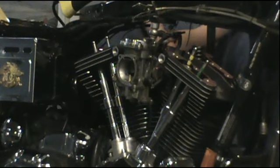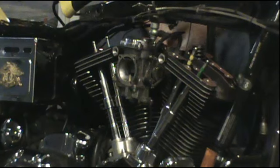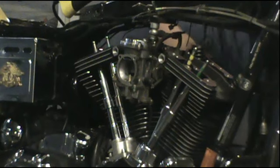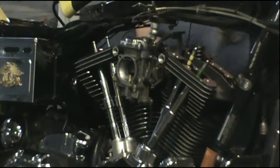Then we brought the jugs with the pistons inserted and the rings gap where they should be, back here to the engine block, and we positioned the pistons. Now, with the back jug, we had to sink the piston into the jug a little bit to clear the studs, and then we put the jug over where it should be, and we used a soft mallet handle to knock the piston out of the jug at the bottom enough just to line up the piston with the connecting rod.